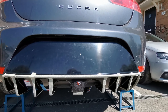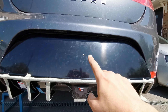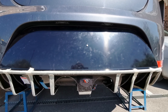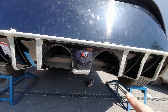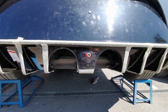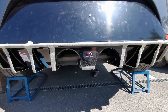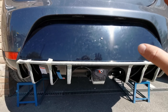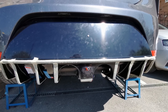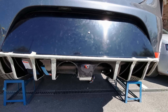I've got the splitter on now and the fitment's pretty good. It just needs pulling down underneath to neaten up the edges. I've tacked it in with a little screw just to hold it onto the diffuser underneath. I've got the inside ones cut out. I've just got to cut out these inside bits, which act as a wind barrier at the back of the car. Once they're cut out, we'll have enough room and clearance. Then it's just a case of bonding it onto that rear diffuser and letting it dry. I'm going to pack it full of CT1 or Tiger Seal, then tape it up down to the edges of the bumper and leave it to dry. And then that is the fitting of the diffuser done.